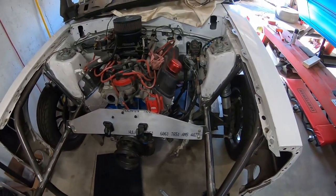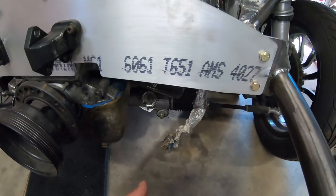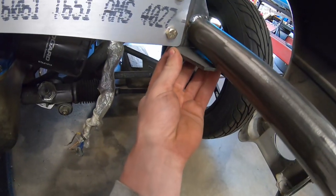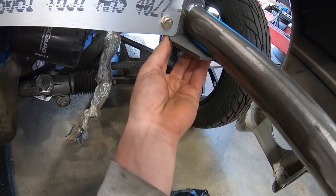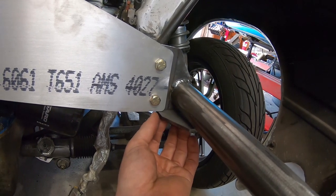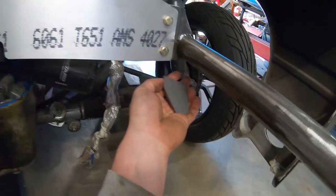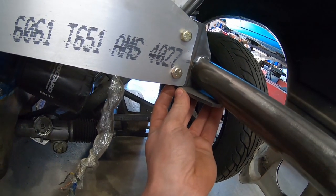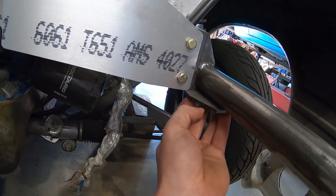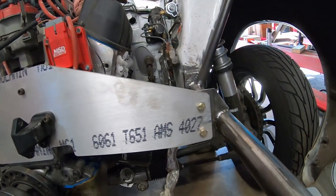To do the mid plate — I had some questions about this. This kit came with these tabs and I had no idea what they were for at first. They go underneath here, and all that does is — you weld it on that tab and when you're installing it, it just makes a good resting spot for the front plate. So I got to weld those on. They're meant for a stock frame rail so it's gonna have a little gap in there. I'm not too concerned — I might try to fill that with weld, or just weld it on the bottom back here and weld it in the front around that tube.